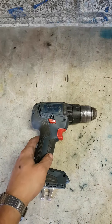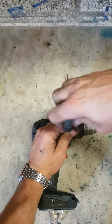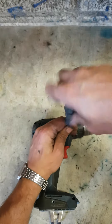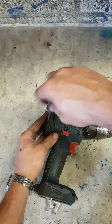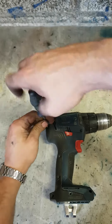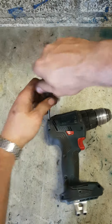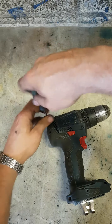Now it says it's a loose wire. Generally when you bang the machine and it runs, we do that for brushed machines based on the brushes being worn out. When you do it to a brushless machine, give it a slap and she runs again — generally it's a bad connection somewhere.